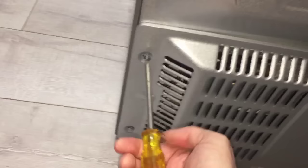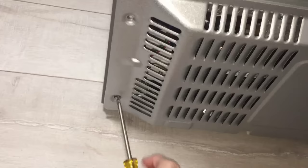The first one is a good running compressor, and notice how it's purring like a cat while it's working. But the second is a bad compressor. It's also running, but it sounds more hollow and empty. And there is also an overload click about every 20 seconds, which prevents this compressor from overheating and causing a fire.